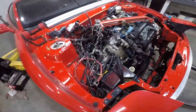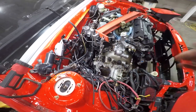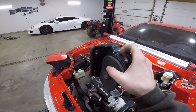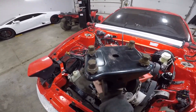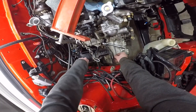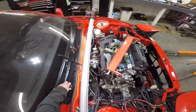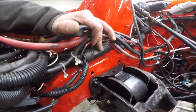I gotta get this bolt out so I can get this chain off, and then that bracket just bolts into those four holes right there. It can go two different ways but it won't bolt up — if you attach it to the transmission upside down the bolt holes won't line up. You see how they're spaced differently? These two that are closer together go towards the front of the car. The bolt will line up but then you see how high this transmission mount's gotta come up — it's gotta come way up. I remember this one being a pain but Jesus it's gotta come up that high.